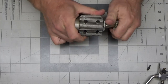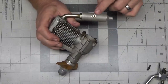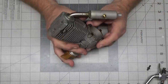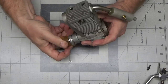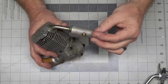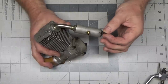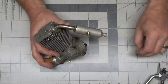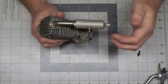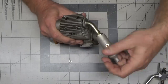What I want to do here is take a look inside. This exhaust or muffler I believe is stock, but as sometimes happens, I was looking the engine over, doing the compression check, rotating the prop through, and I touched the nipple — just touched it — and it came off. It wouldn't really thread in, so it's almost like the hole had been wallered out. Off-camera I just reamed that hole a hair and threaded in a new brass nipple I picked up off eBay.